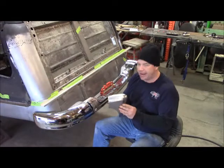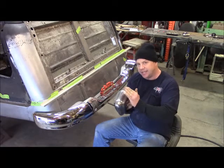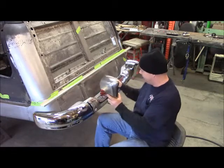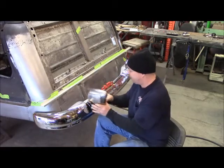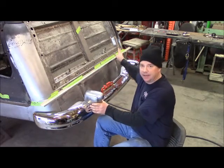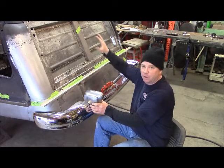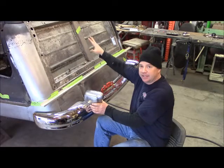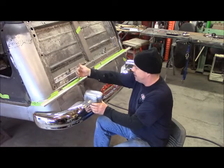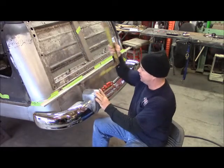I'm close now, and I want to show you how I'm getting the alignment on this. I went to the crest of this, and it's not 100%, but I was able to dial in a straight line right down the center of it, right down the face of it. And I've been using a level for this one, and then for the one here, I've put this square straight edge up against the back of the body here, which I know is square, which goes all the way back to when we was setting the floor and setting the post and getting all that exactly square, level, and working my way back. Now I shoot this number off of this out through this using that straight edge and this big large square here.